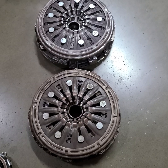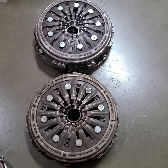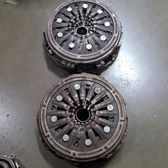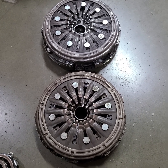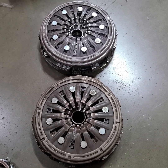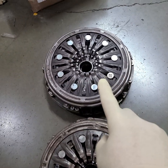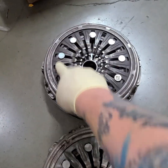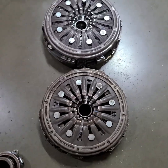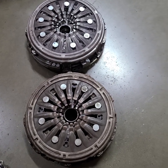A lot of people are saying that their DCT TCU tunes will hold more power, more torque - no, it won't. You might get another two to eight percent with a TCU tune, but they're not going to put different diaphragms on clutches if they can just program the TCU for a different value.